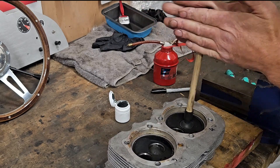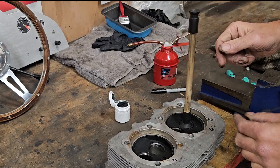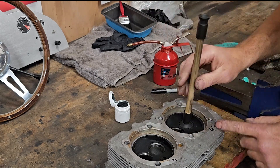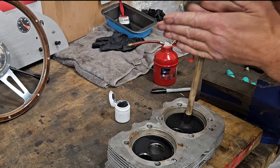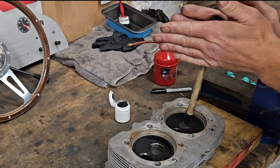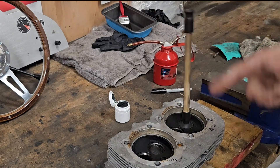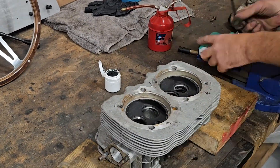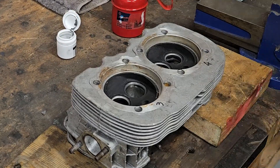The paste is grinding the face of the valve seat and the valve face into one another. When it sounds smooth, just give it a little tap to bring the paste back into play on the seated area. I'll get all of these done — watch that sped up. That's the valves all lapped in. The seats and faces on the valves look really good, a great match and perfect gas seal. Next is assembly with our new bag of springs.